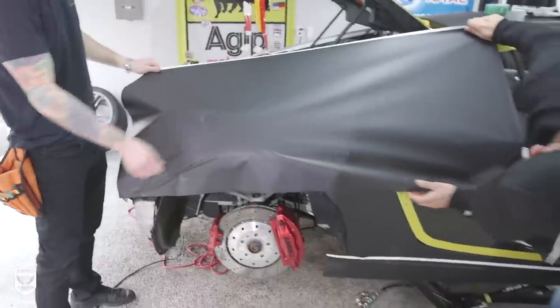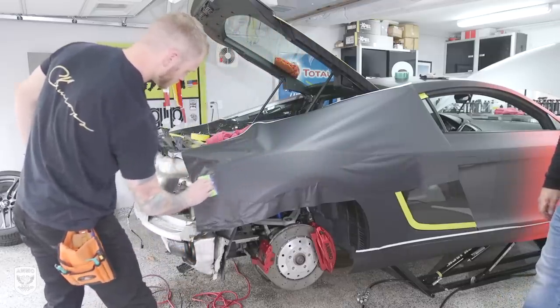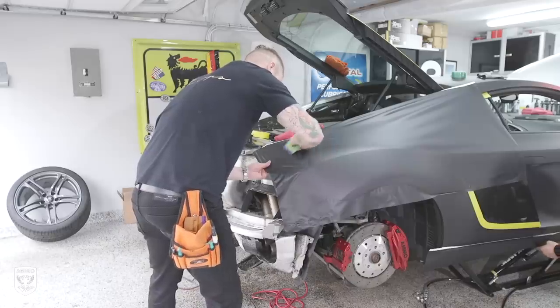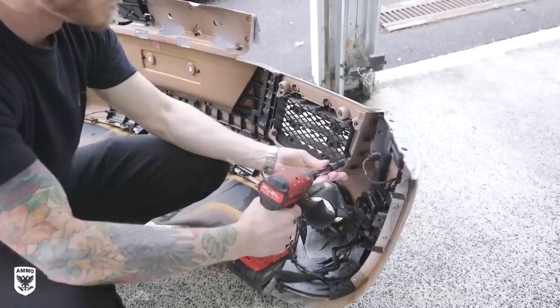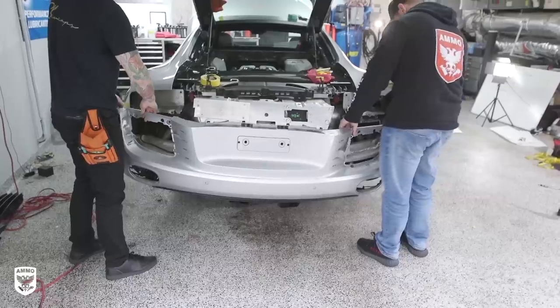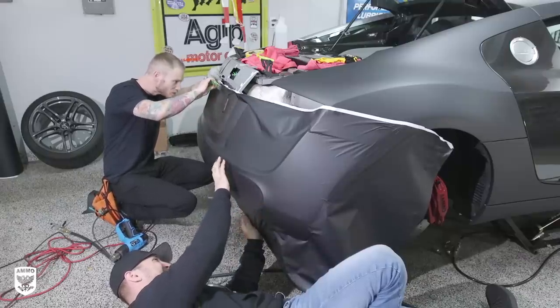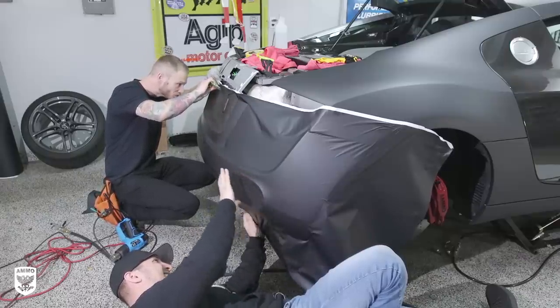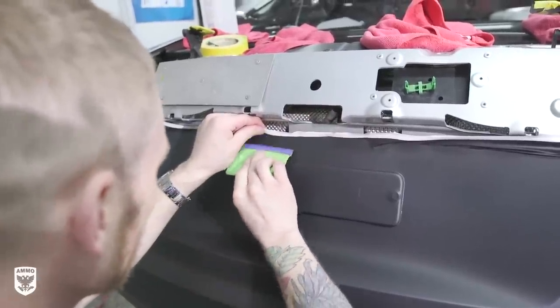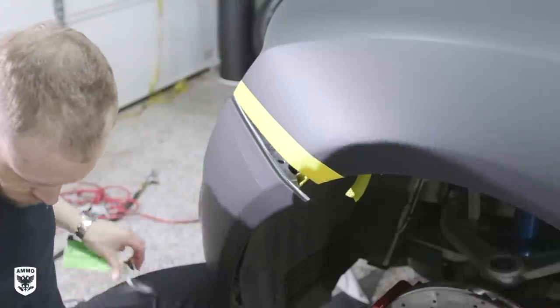The roof film is put in place to match the fade on the door, then stretched, heated, squeegeed, and knifeless taped for a perfect edge. Once the fade was done, the back and front are slightly easier since they're solid color changes. For the R8, the rear is just matte black and goes on without issue. However, the rear bumper is more complicated — the exhaust tips and black louvers are removed, and the bumper is lightly mounted back with one or two bolts so Christian and Tom can pull and stretch the film without it wiggling.